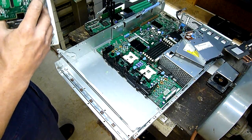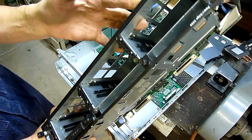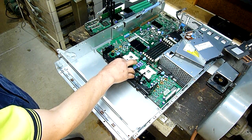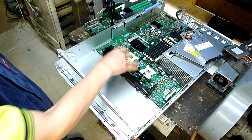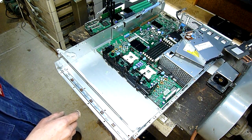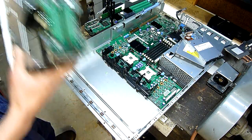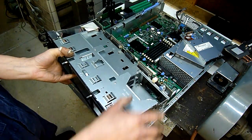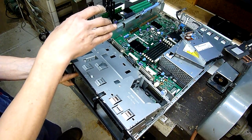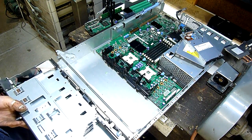That's a Dell PowerEdge 2850. It's capable of two PGA dual-core Xeons — that's about it. I'm going to modify the chassis heavily, including stripping some of the drive bay down and mounting two ATX main boards in it, with at least one or two optical drives — though they're not that necessary these days with solid-state drives and USB sticks to transfer data.